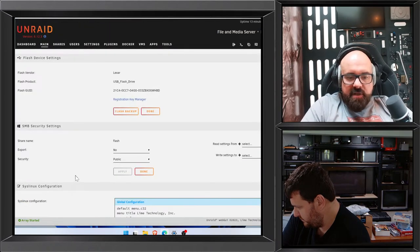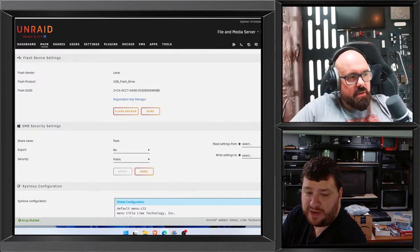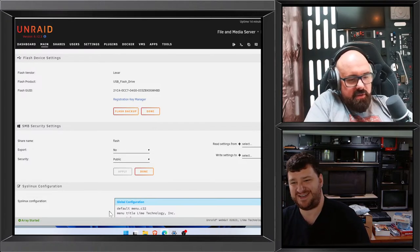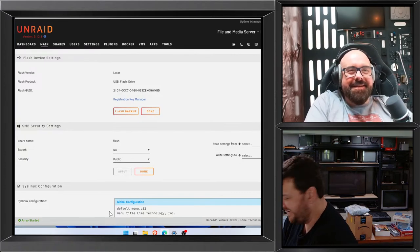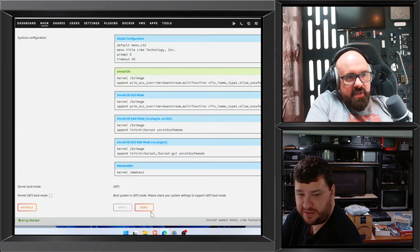So inside of the motherboard BIOS, you must have, is it called CSM? Compatibility support module enabled, I think it's called. I might be wrong. I'm going to plug my server into this capture card so we could all see the motherboard settings on stream. Cool. I'm so lucky. Wow, I already moved my server. That's clever. All right, so now I just reboot. Correct. Yes, just reboot. So I'm going to hit done here. And, yeah, done there, and then reboot.